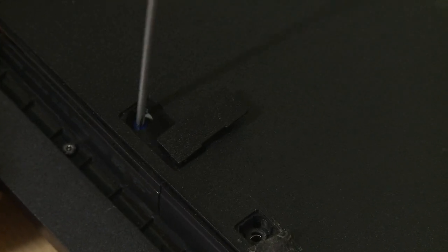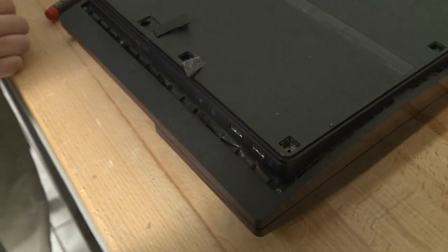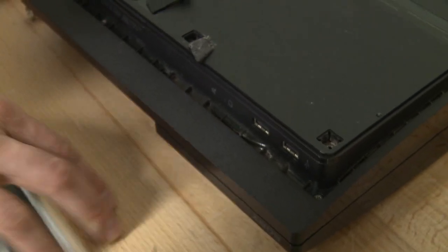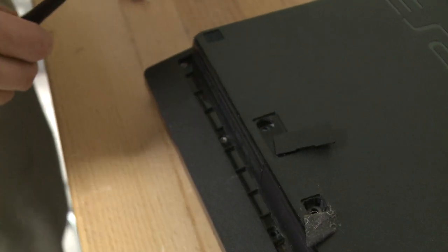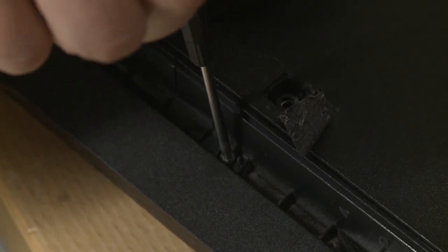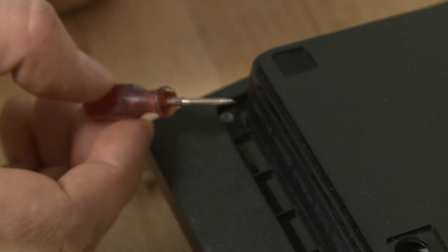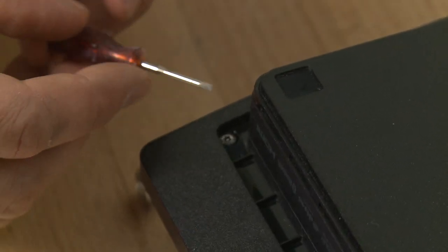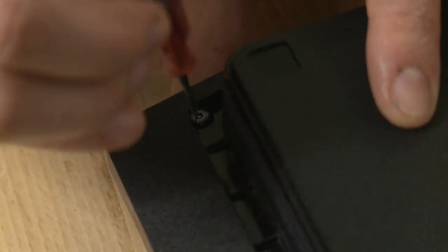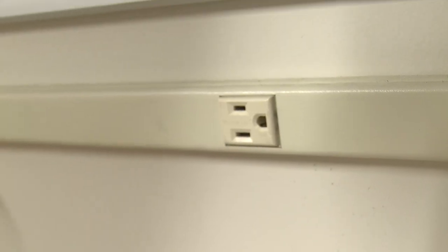There's a little blue Phillips screw in there — you see that? You just pop that out too. And there's four star-shaped security screws on the bottom. Most people don't have that tool, so I just use a regular star-shaped screwdriver. If you push down, it gives you just enough to get it out. What's even easier is if you have a tiny precision flat head, you can wedge that in there and turn it — look at it turn. Make sure your plug is not in when you're working, so that way you don't hurt yourself.